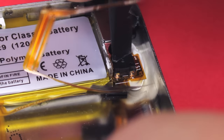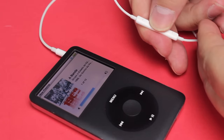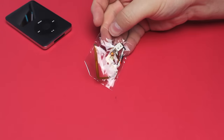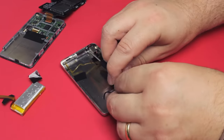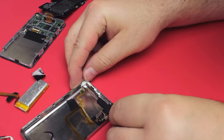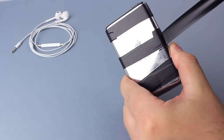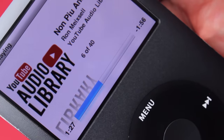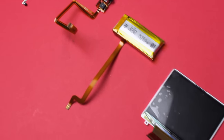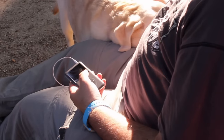The last problem I had was during my attempts to fix the headphone jack. Without the lateral screwing point — maybe I bent it or whatever — the integrated click speaker stopped sounding, and the earbud controls were not working properly anymore. So I found a replacement set on eBay: a full set including the headphone jack, the click speaker, and the hold switch, all together ending on a contact ribbon. At this point I was utterly in panic about doing something wrong — fix it here and damage something else, getting stuck in some fixing-iPod groundhog day. But it wasn't the last time. I glued it back together, and on the next day it was all perfect. The whole project was not cheap — mostly because I had to buy the SD card twice, two batteries, a new screen, and a new headphone jack. You could argue this is not even my iPod anymore, and you'd have a point. But I look at it and see my wife's engraved message, and I'm so glad I will continue using it.